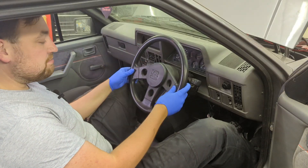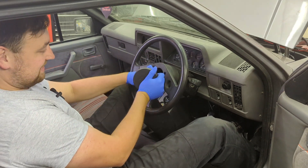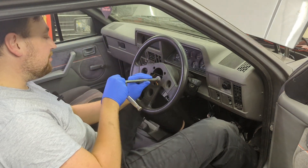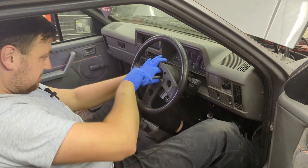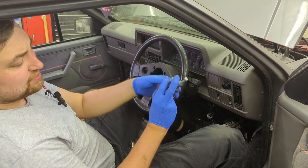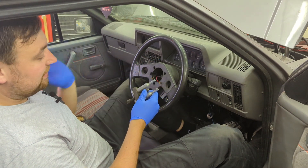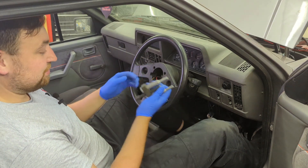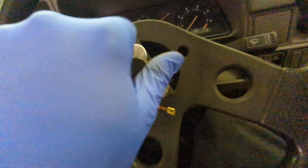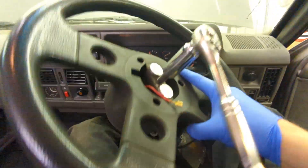The first thing I'm going to do is remove the steering wheel. This is a factory three-spoke. The horn just pulls off, wires pull off the back, then you have a 22mm nut behind it. I'm going to use a dedicated Vauxhall steering wheel puller — it's about £11 from Laser, really handy. It's so much easier than just trying to pull it, and if you do pull it you can sometimes break them. Look at that — really easy.